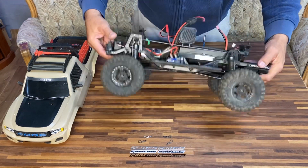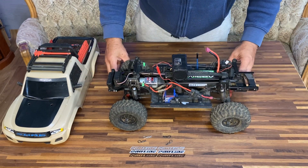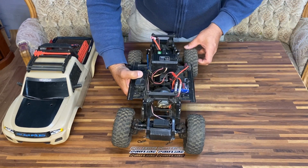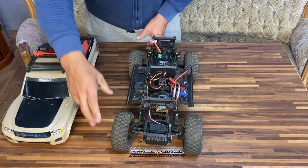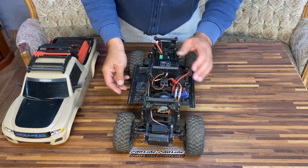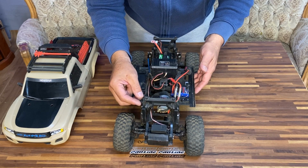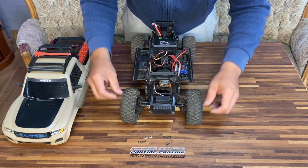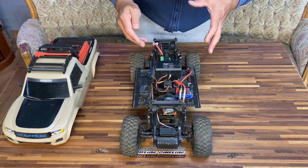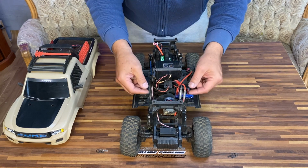And now coming to the side hilling strings. These strings here don't allow the chassis to tilt on side hilling. So this was actually the idea, that when the car side hills, the body doesn't twist over and pull the car over. So the droop of the axle, which we've spent so much time on with the flex kit and shock towers to get more droop out of it, this actually prevents the droop again. So it has a negative side to it.